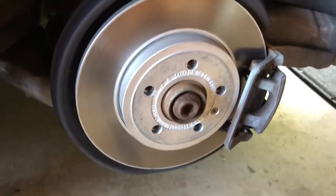The two main reasons I'm doing this: if any of you guys have Euro cars, you know it's a little annoying when you're running a spacer and trying to line up the wheel and the spacer with the hub to get the lug bolts in. That's one reason — won't have to deal with that anymore. Also, running the 5 by 114 wheels on here without having to redrill the wheels or get adapters. It's easier to put the wheels on with studs, so those are the main reasons I'm doing this.